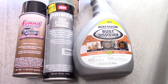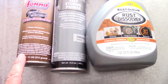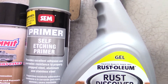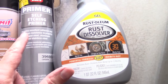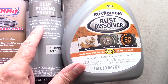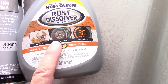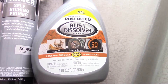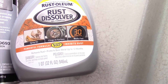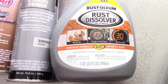To start my rust treatment procedure here, I picked up three different products. I've got Summit Racing's brand of rust converter. This is what I got at the paint shop — it's a SEM primer, self-etching primer. It says it has corrosion resistance, but I don't really think this is what I wanted. This stops corrosion; this has corrosion resistance — I think this is going to be used after I treat the metal. And then I got this over at Home Depot or Lowe's. After reading the directions for all of these, I'm going to treat my hood with this first, and then use this self-etching primer.